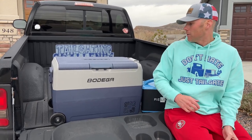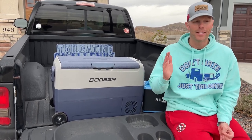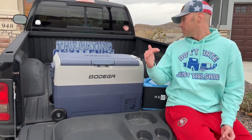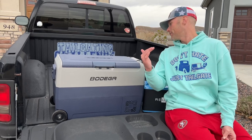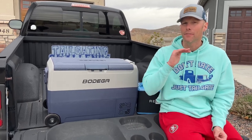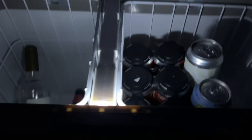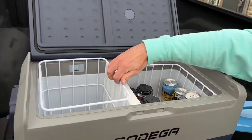My feedback for awareness: there's a floating zone in there. We had it set at 37°F for the fridge and 5°F for the freezer, and it's floated from 5 up to 20 and from 37 down to 34 and up to about 40. There's some variability — it runs in cycles and keeps temperatures around the set point but doesn't fully lock it in. There's also an interior light in the cooler that we'll show at night. It'll keep your beer nice and cool, and it has removable dividers inside as well.